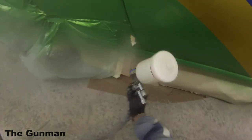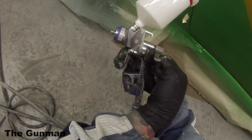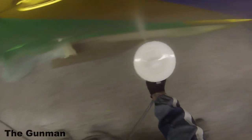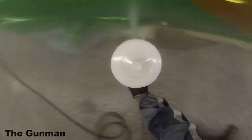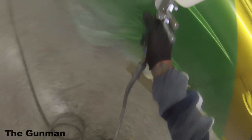There's only really one thing that you're battling with when you're painting in the cold. It's pretty simple, it's heat. Now, if you can't get heat out of your booth or out of your panel, what's the next obvious thing to do? Get heat out of your paint. And it's really quite simple once you think about it, but if you don't know it, you don't know it. Get as much heat as you can. I've got that kettle, just boil it and boil it and boil it. Get heat into those cans, tip out the water because it's going to cool down, and put hot water in there again. At a guess, I would say this paint is sitting around the 50 degrees even.